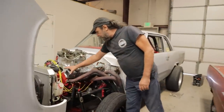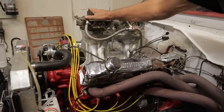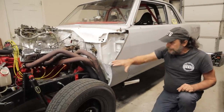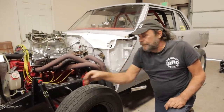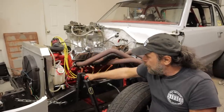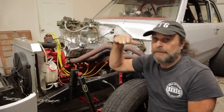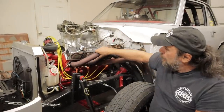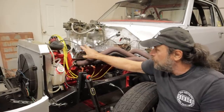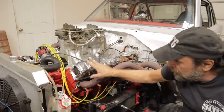Looking at one cylinder of this engine, there's only one period of time when the tip of the induction system, whatever it happens to be, and the tip of the exhaust system are completely connected - one path through the whole package. And that's during the overlap period. The exhaust valve is closing, the intake valve is opening, the piston is at top dead center. During that period of time that those valves are open, the combustion chamber is at its smallest size because the piston is at top dead center. The pulse of exhaust is working its way out, and behind this high-velocity exhaust pulse is a void, a vacuum - and that vacuum, during that period of overlap, is allowed to pull the initial charge through the intake system.